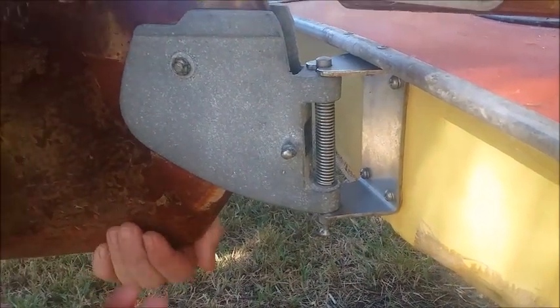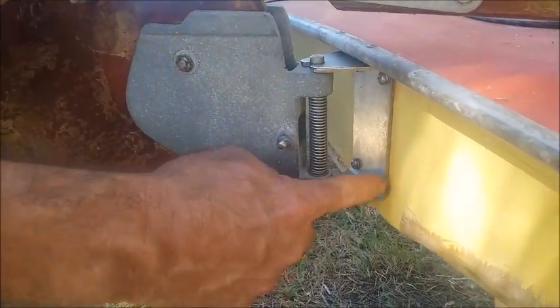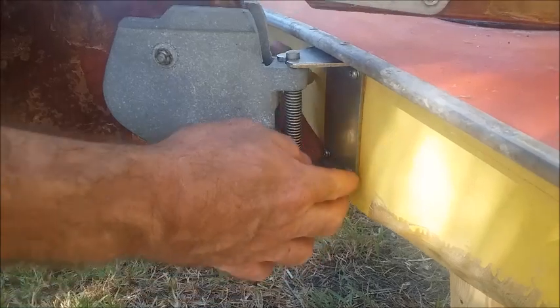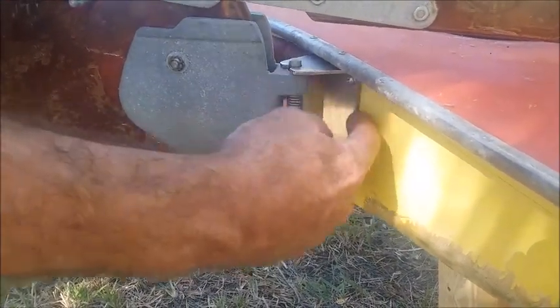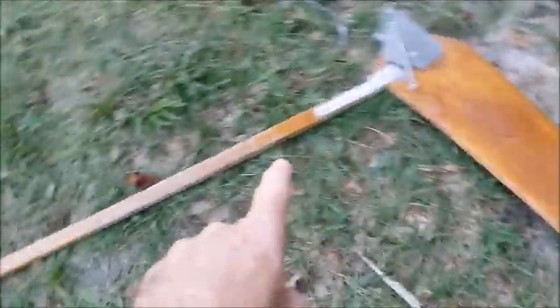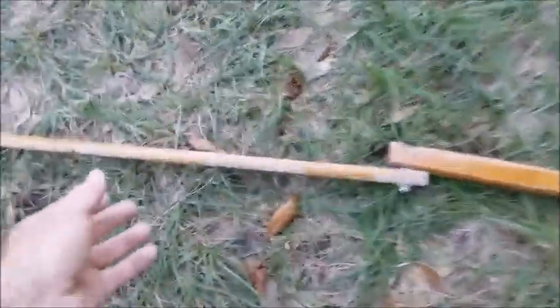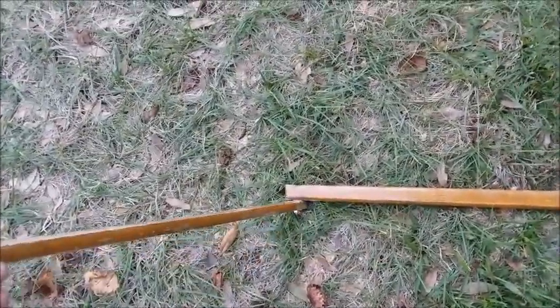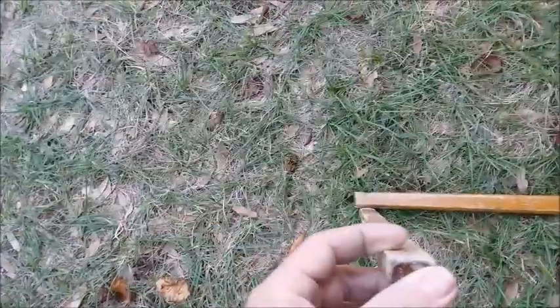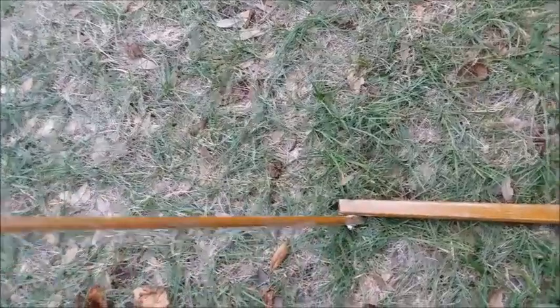Just like that. I have not seen too much damage on this part of the boat. But certainly a good thing to check for any re-drilling or patchwork. The rudder originally came in three sections: the rudder, the handle, and the handle extension. On about half the boats you'll come across, this extension is often missing. It's real easy to make another one out of wood and just reattach it — it just has a stainless steel bolt that goes through both pieces so it can swivel.